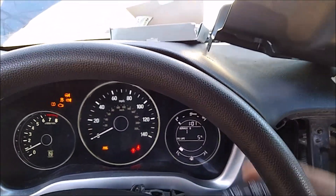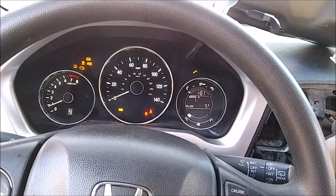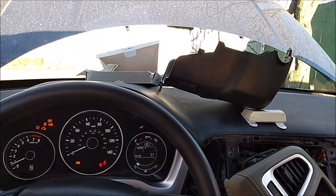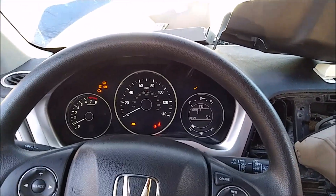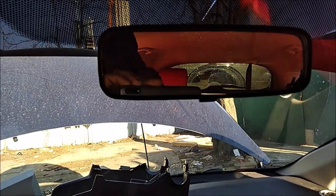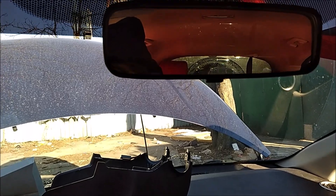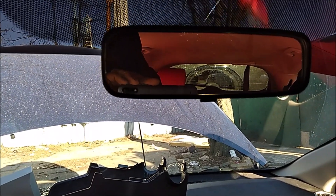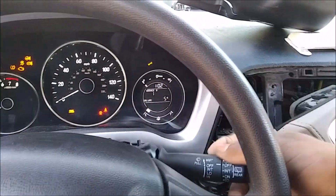As you can see, there are no front wipers. When you put the vehicle in reverse, the rear windshield wiper comes on — and when you put it back in park it shuts off. Maybe that could be a feature, but the customer says it wasn't doing that before. So the only way to get the rear wipers to work is to shift into reverse.